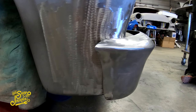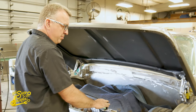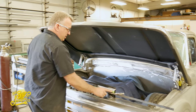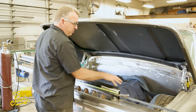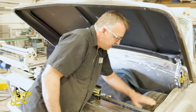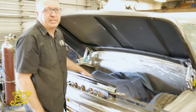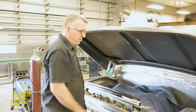Up above, where the factory core support is, I'm cutting that all down and smoothing it out. This will be trimmed down to better fit the top of the radiator, and we'll build a cover here. There'll be an inner fender well that comes in and keeps that same shape of the factory line, curving in nicely — simple and clean — so it emphasizes the engine and doesn't take away from the rest of the truck.